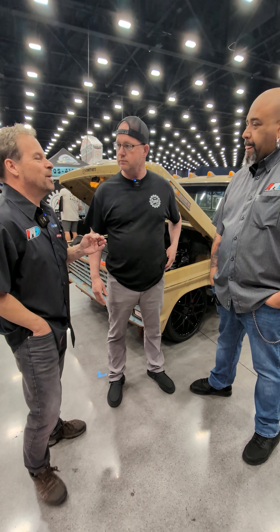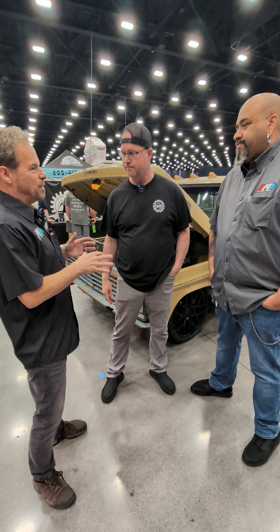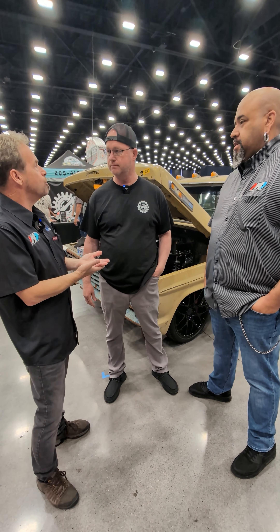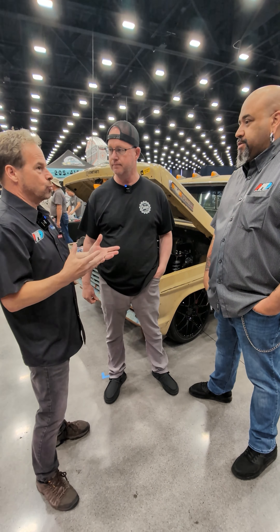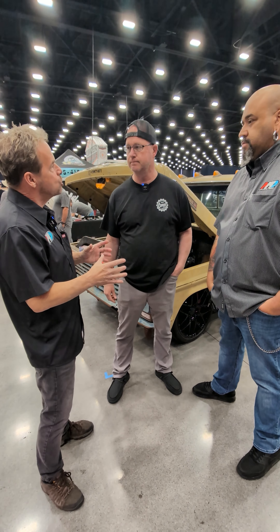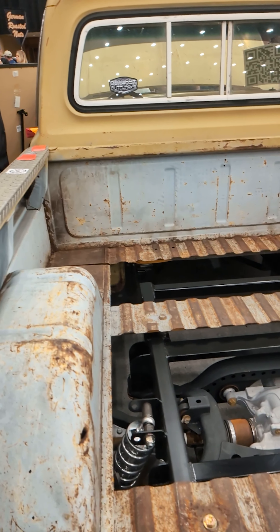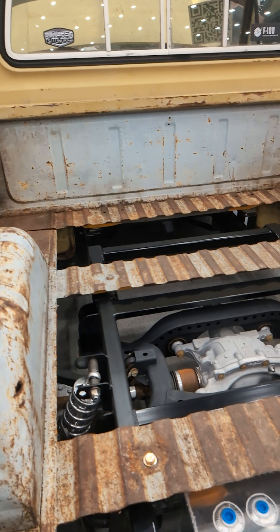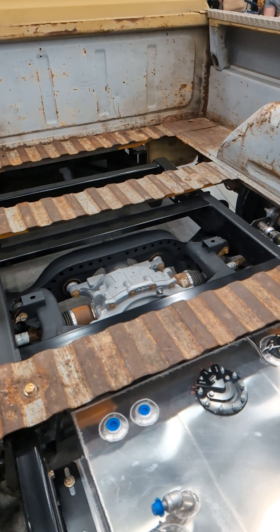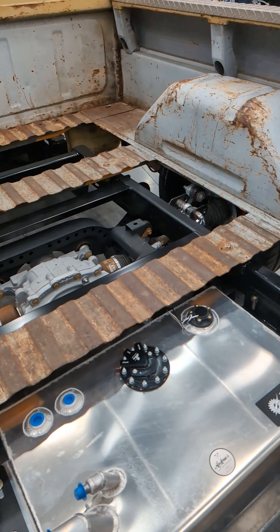The cool thing about this is you see a lot of people doing the P71 conversions, but the bed floor in the back — when you do a full Crown Vic chassis, you've got the axle large so you lose your bed floor. Some guys are grafting in early T-Bird IRS's in the back to keep the bed floor, but it's a lot of measurement, and if you're not very good with a welder you may end up with something unsafe. With this, I keep my flat bed floor and get modern suspension geometry with an S550 Mustang. That's a great handling car, and it just solves a lot of problems.